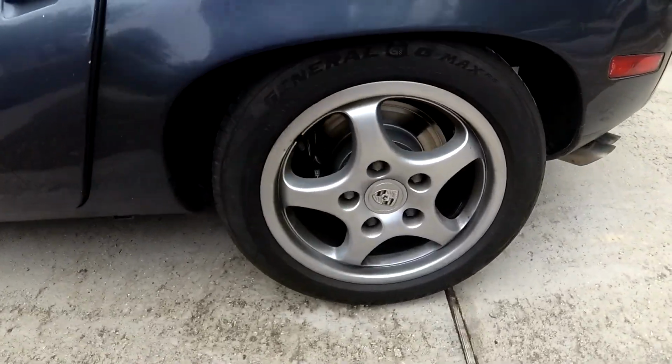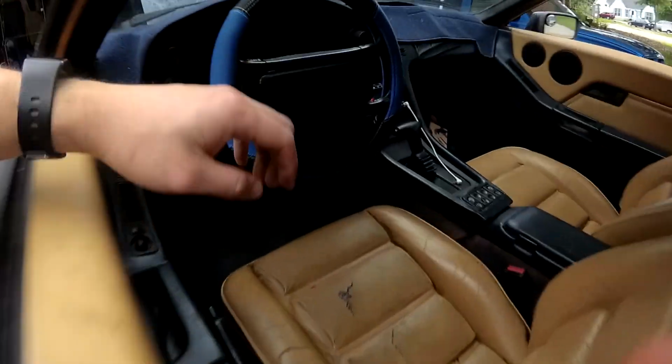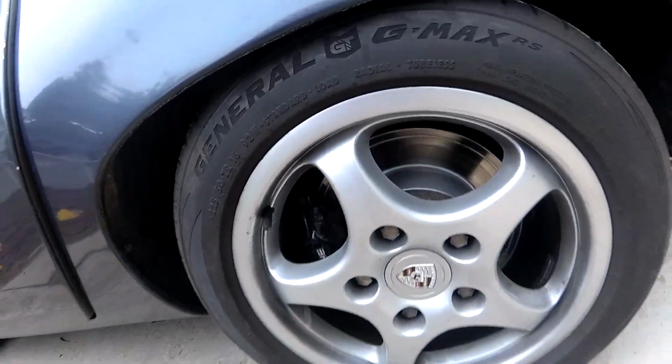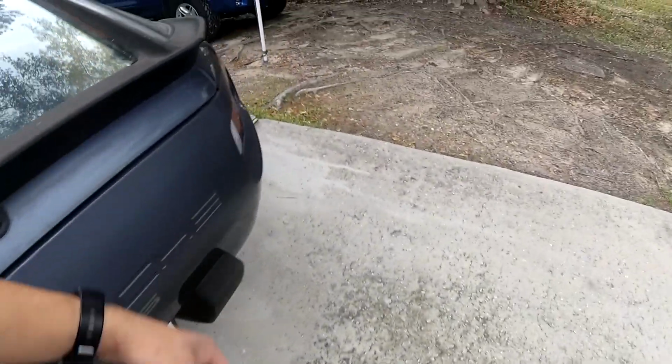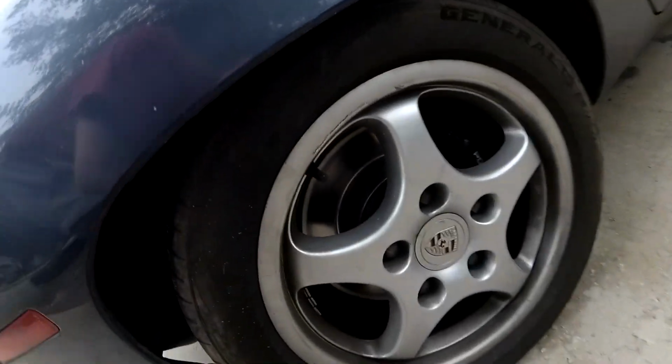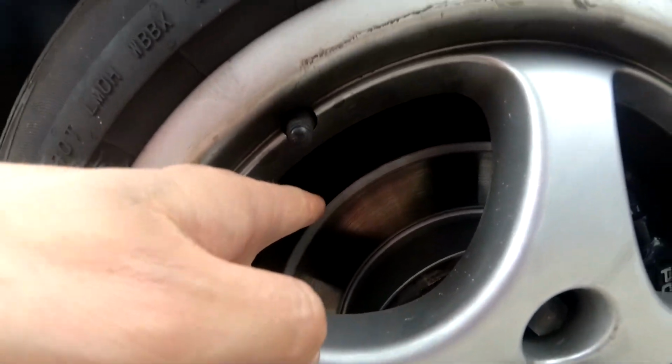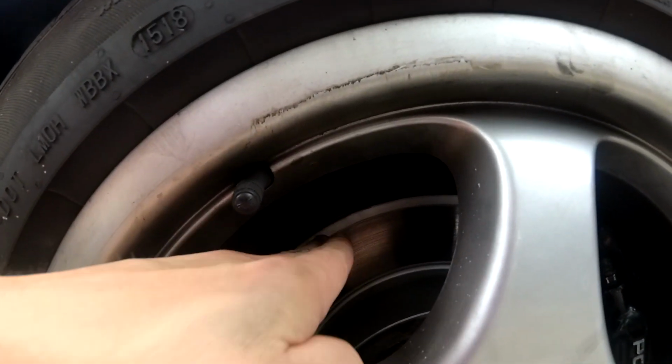We went out and used the brakes some. I'll shut the AC off now. And it seems like they're wearing a little better to the rotor now. See, this one wasn't making much contact at the outer edge, and yeah, it's working its way up there. A lot more, like from about there up, wasn't touching before, so they're wearing in.